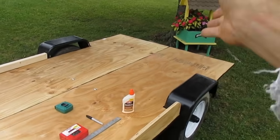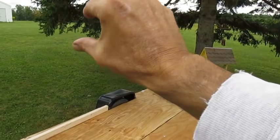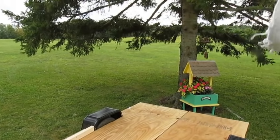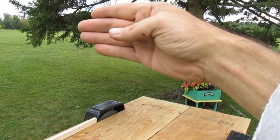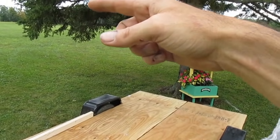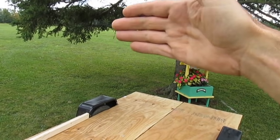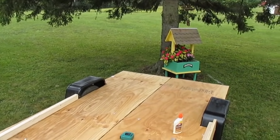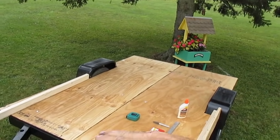After the rail is glued and screwed from the bottom, my plywood walls get screwed to this rail piece with glue behind it — two beads of glue running all down the side of that two-by-three. Then when my wall goes against it, I screw it right to that board, and that's how you raise your walls all the way around. Once the walls are up, I notch out my plywood and put my rungs so the rungs fit down inside the walls. The reason why I notch it out is so that if a limb fell on the camper, the rungs couldn't be forced to slide down — sitting inside a notch with L brackets on either side creates a cradle to hold them.